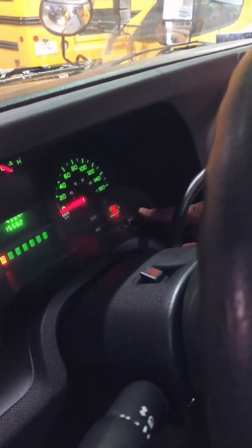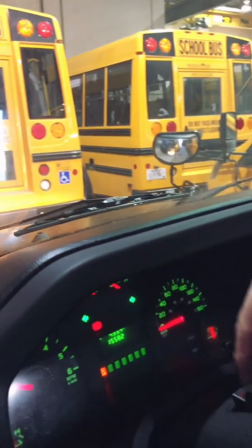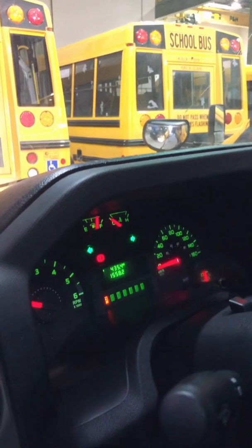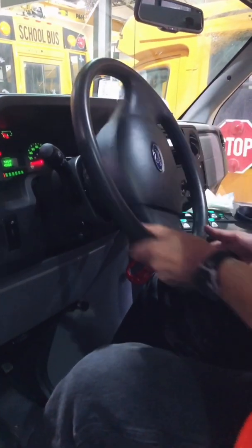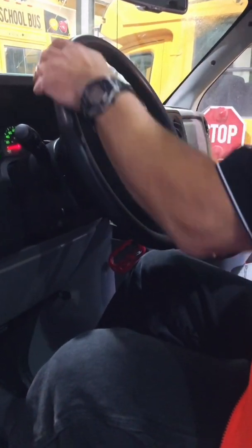so that's pretty good. As I continue to work my way left, this is my 4-way hazard flasher switch. I'm going to turn that on now. I want to see that I have 2 lamps at the front, my lamps work, and the switch itself works. I'm now going to check the steering to see that it works, and it does. There's no excess of free play in it. I'm going to turn it all the way to the left, so I'll explain later as we go across.